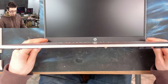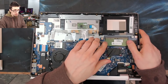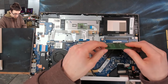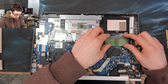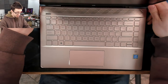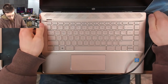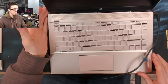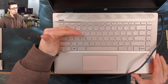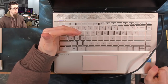Okay, let's try giving it different memory. I'll pop out that memory module and put in this known-good DDR4 stick. Charger in. Power button. Power light. Three long, two short. Same deal. Exactly the same issue.